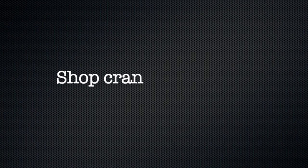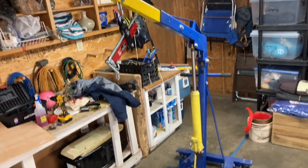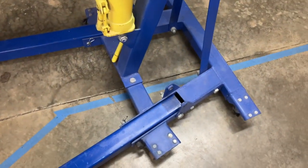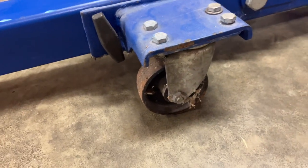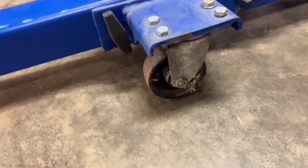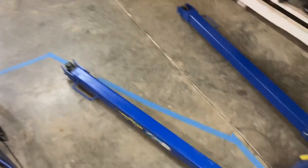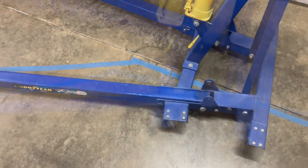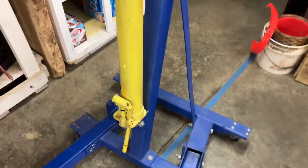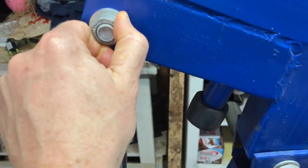Next I'm going to talk about the shop crane, one of the key pieces of equipment you're going to need — also called a cherry picker. One of the things you'll want to do before you get started is make sure the wheels are spinning freely, that the bearings are greased, or use Teflon spray. You'll also want to have swept the floor where you're going to be working — no debris that'll stick to the wheels and gum them up. Also check your long ram and make sure it has enough hydraulic fluid, that it works and holds. Check that all your bolts are nice and tight.